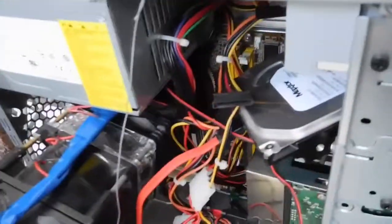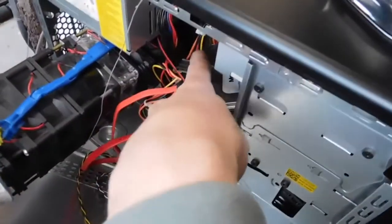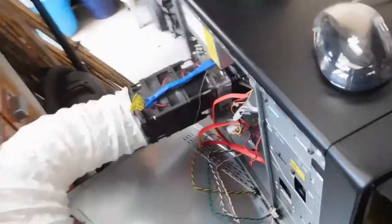rather messed up Dell casing from that Inspiron. The board in that was dead, so I put one of those ASUS boards in, which is inside that tangle of mess, and we've got a couple of hard drives which I'm having issues with. I'm guessing these are because there were two of these P4 Pentium quad cores that they must have been out of home server computers or something, but at least the hard drives from them are really misbehaving, and also managed to blow up the CPU cooling fan for it, so I just figured I'd do a bit of a redneck repair on that and just get some fresh air to it. But we'll put some power to it and see what happens.